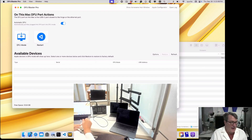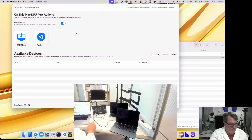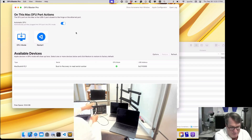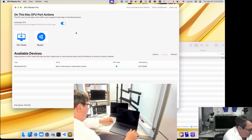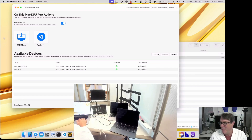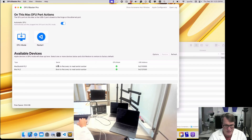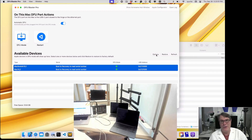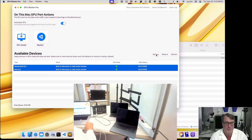Since this hub is USB-A to C, I'll plug into USB-A, into this port on the back — it has to be the DFU port on the target Mac — and do the second one as well. You can see they both appear in the available devices list. I can select them and click restore, and it'll use the Apple Configurator command line tool to restore them using the macOS version selected in options. Here I'm doing two, but I could put 10 devices here. In fact, this hub is split, so you can go up to 20 devices by plugging into another USB port on the Mac. So I could do 20 devices all at once. That's scenario three.